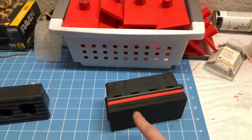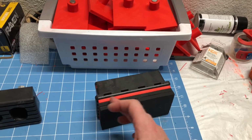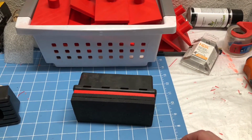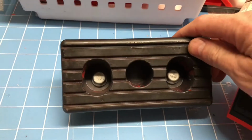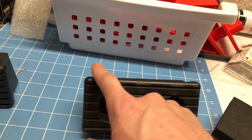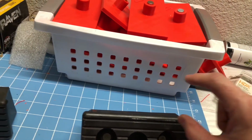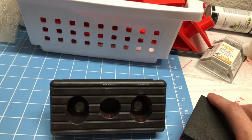And you want to center it, of course, center that right on here and here, the center of that jack pad. Your average new age floor jack, the lift area is about 4 inches in diameter. Well, that's not 4 inches. That's about 2 3/4 inch. Therefore, it's going to overhang. And on the Tesla, just a hair inside here is going to be a strip of rubber, a plastic piece that runs across, that holds the bolts that hold that up in there. That strip is very expensive, hundreds and hundreds of dollars.